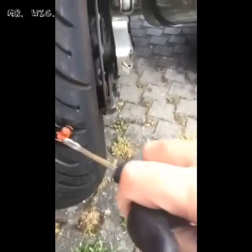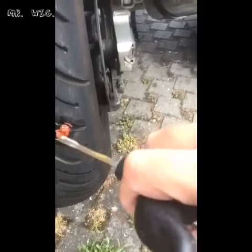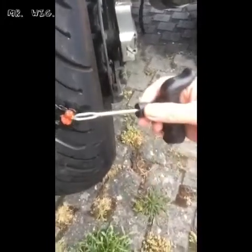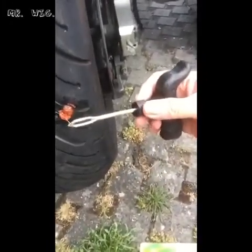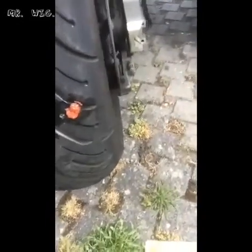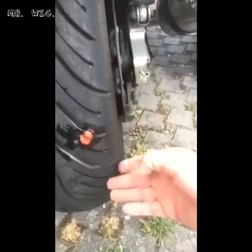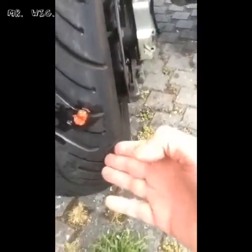That shows how tight it is, because the hole is small, but because the rubber is wider, it's going to seal it 100%. And if it would stay a couple inches after, cut it. If not, you can leave it like that. It's less than an inch, and with the rotation of the tire, it will disappear, and it will stay flat to the tire. So I hope this helps, and all the best.